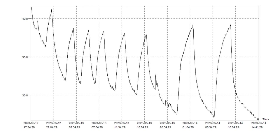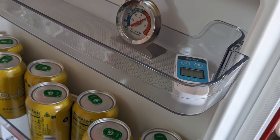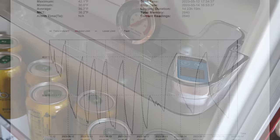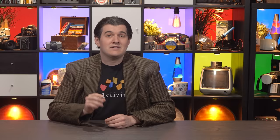Where previously it had been kicking on at 38 degrees and satisfying a hair below freezing, now it wasn't kicking on until the interior reached a bit over 39 degrees, and worse, it would stay running until we were down to 27 degrees — that's minus 2.7°C. That's weird, but did we at least make the temperatures inside more consistent? Nope, we made it worse! Okay, that's not entirely true. Probe 2, placed on the top shelf of the door, used to be averaging right around 40 degrees, and adding the fan brought the average down to like 37 — so that's good, I guess. You could now feel safe keeping whatever you wanted up there. But probe 3 in the door's bottom shelf got much worse, and so did probe 4 in the crisper drawer. We made the top shelf more consistent but everywhere else in the fridge got warmer.